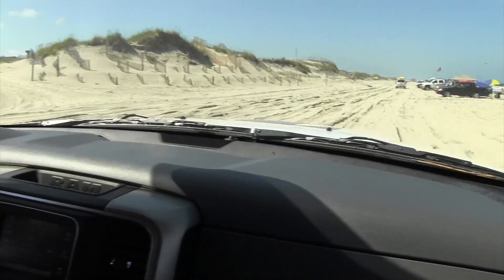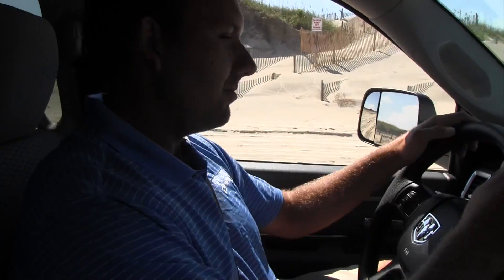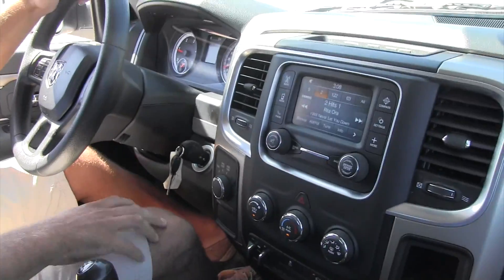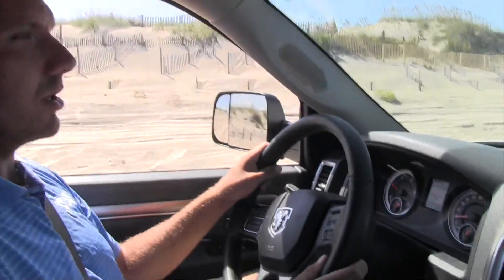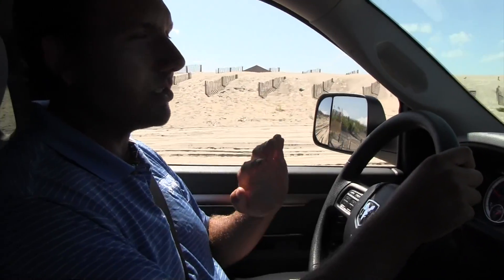One of the reasons I wanted to do this video today — I don't know if you can tell from us going up and down — but we're going about eight miles an hour and I can't go much faster because the beach is so rough today. Just deep tracks, up and down. It's about as bad as a beach as you would have pulling a trailer, and it's driving fine. I am in four-wheel drive; I don't think I'd have to be right now — I'll actually take it out just for fun. If you're driving a full-size truck and you're getting some axle hop where the whole thing is shaking, definitely just stop and air the tires down more; even two to three or five pounds lower in each tire will make a huge difference.